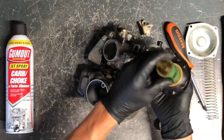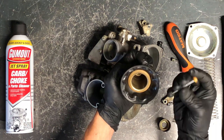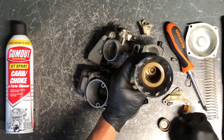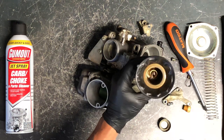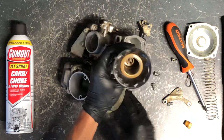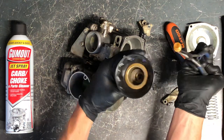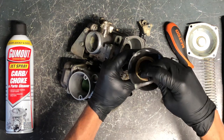Dump your needle out — there's your needle. Sometimes these needles are adjustable on different models, but this model has a needle that's not adjustable; you can replace it and get a different size. The needle slides right down the center tab. To reassemble: set the needle back down in there, take your spring and set it down, making sure it seats properly. Use small pliers if needed. Take the cap and set it down — the spring will pop right out the center. Set the outer cap down over the top of the spring, then take your allen wrench and tighten it back up.